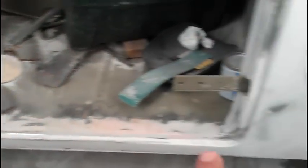On another note, I've been working on the '50 — it's coming out nice. It's almost ready for 80 grit. I've got a couple of low spots still on this section, but for the most part the quarter is done. I'm going to start working my way around the back. All this is straight. I went ahead into all the door jamb — it's all done, just needs to be hit with 80 grit. You can see how nice it came out.